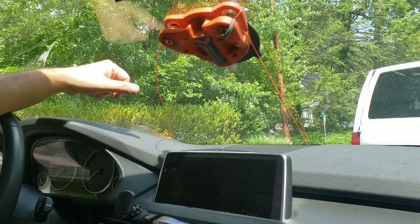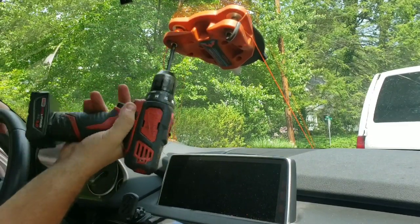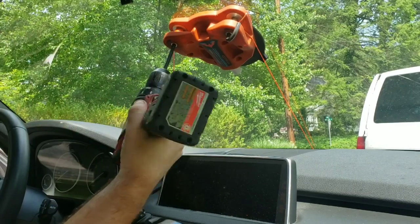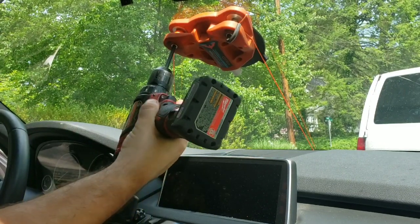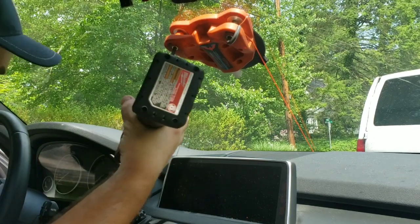Basically, back to the orange bat — you set it in the middle, leave the tool here, you don't want to move it. I start a little bit and then go one side and the other from the middle. This trick is good with German cars because Germans don't put a lot of urethane at the factory, so basically it's easy to work with them.